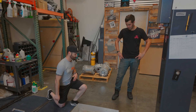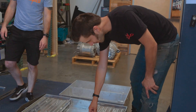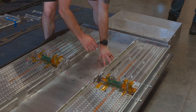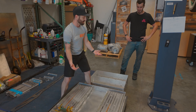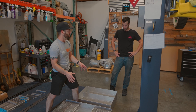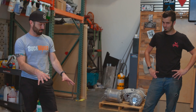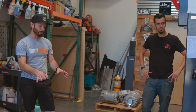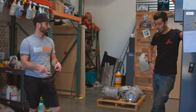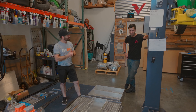The difficulty with mounting these modules is that the only places you can grab them are the side rails. You've got coolant ribbons, circuit boards in the front, and terminals on plastic platforms that if you over-torque them you can take them out and can't tighten them back down — they're fragile. The side rail is the only structural thing you can mount them with. This is actually my third iteration of trying to mount these things so they won't move laterally or vertically, and I think this is a pretty good formula.